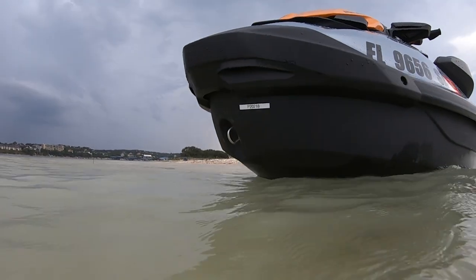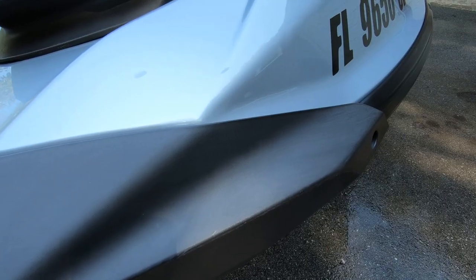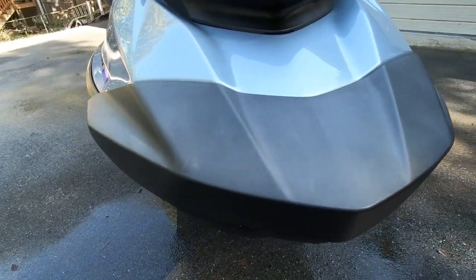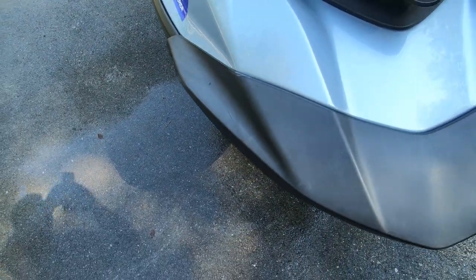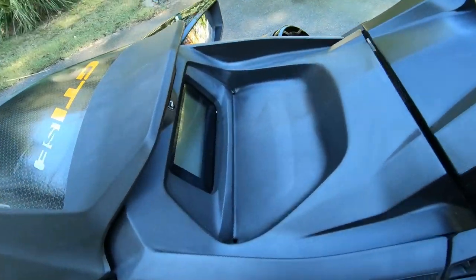This means that today's watercraft are more and more typically black molded plastic than painted surfaces. Unfortunately, despite modern blends and advanced treatments, plastics can quickly fade if left uncovered. Damaging UV rays can leach away vital elements in the plastic's polypropylene composition, leaving it bleached white, and if left out too long, even chalky and flaking apart.